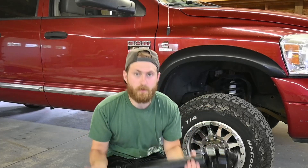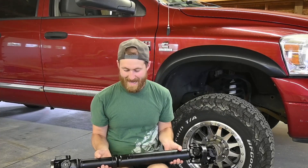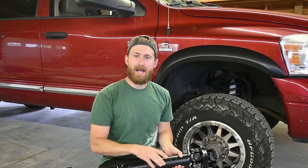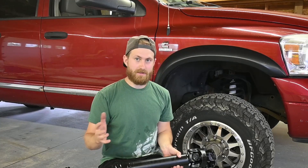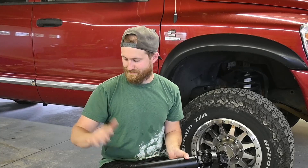So that's where this driveshaft comes in. This is just a Dorman — nothing crazy. This one actually doesn't even have a grease fitting at that joint; it's a sealed grease fitting, so not ideal. There are definitely more expensive units out there that do have that, but I just wanted something to pop in quick and cheap. So this will do for now — I'm going to pop this in and take the old one out and show you guys what I'm talking about.